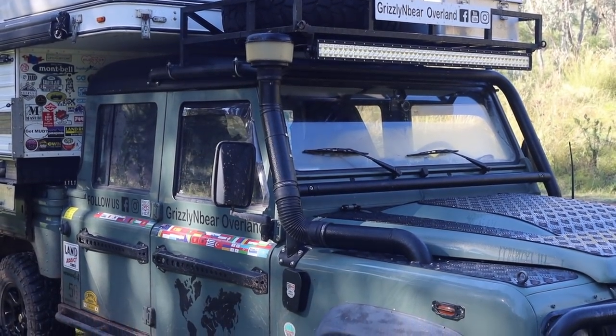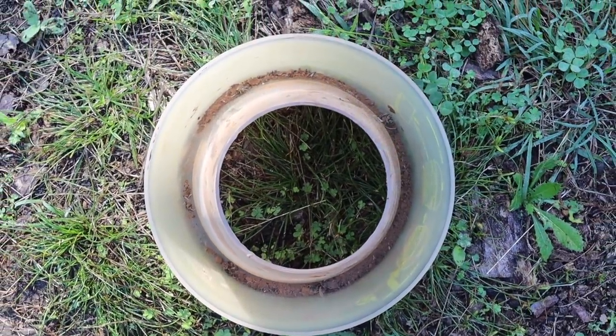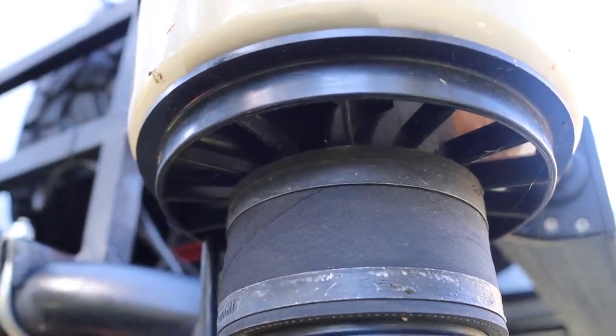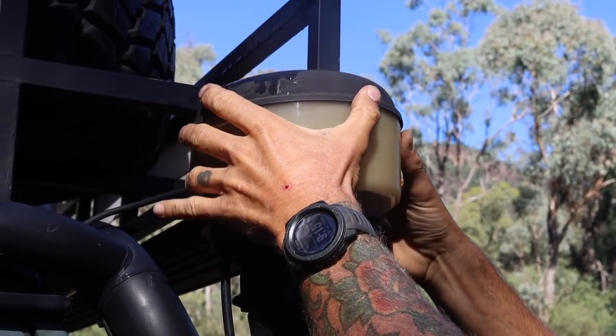Let's talk about a few of the benefits of a raised air intake. The air intake to your engine is raised significantly higher than standard, enabling it to pull cleaner air above the majority of dust and debris levels. Our raised air intake acts as a pre-filter, catching most larger pollutants before they hit the main filter. Our intake minimizes water ingress by having the air intake below rather than forward facing. It's super easy to install and, other than emptying the catchment can every now and then, the system is completely maintenance free. If installed correctly and made 100% watertight, a raised air intake can allow your engine to be completely submerged in water — though we'll be leaving those water crossings to the braver, more hardcore off-roaders unless left with absolutely no other choice.